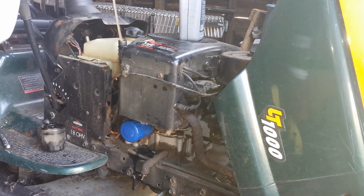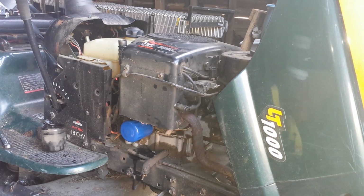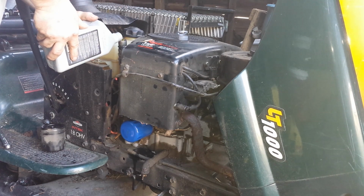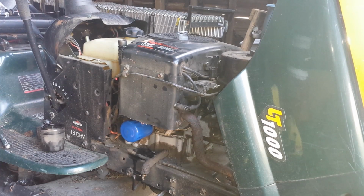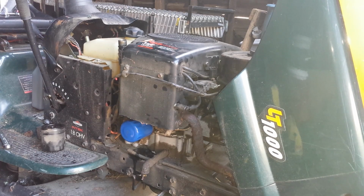So, get the dipstick in there, and it's below the low mark. It's possible that this engine even takes 2, but I don't have any evidence of that. Somewhere around a quart, or that's somewhere around half a quart. Let me put the cap on this. And looks like it's actually going to take 2 whole quarts.